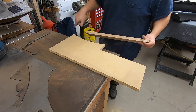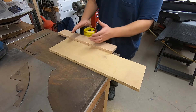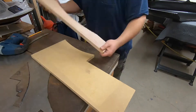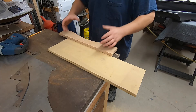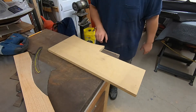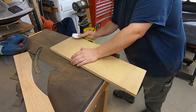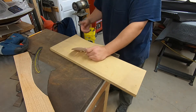I'm going to take a piece of oak and make it basically the same curve, give or take — this would be the piece we put on top to clamp down. So imagine that's our piece — set it here, clamp it all nice and tight and just beat it over. But before that, we put a tiny radius on here. I just do that by hand — I just want to break this corner off since the metal can't make a 90-degree turn. You need a little bit of curve, and the factory was curved too.